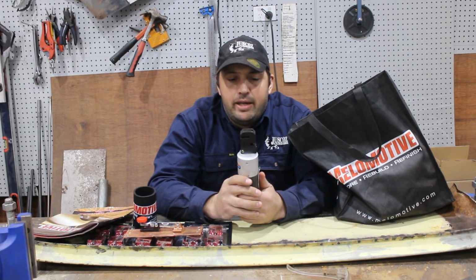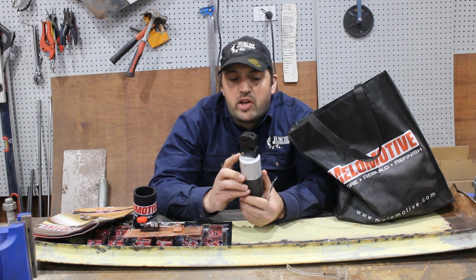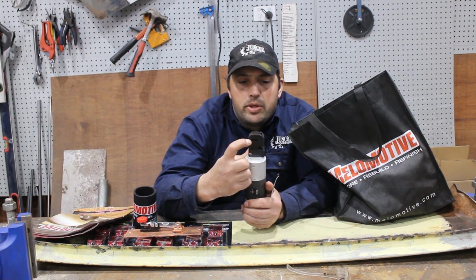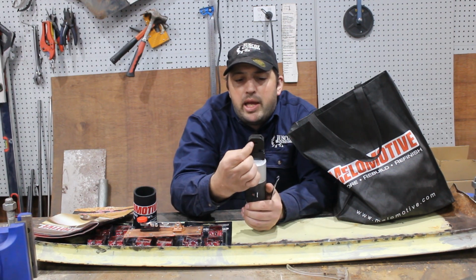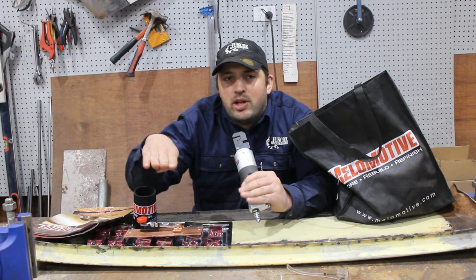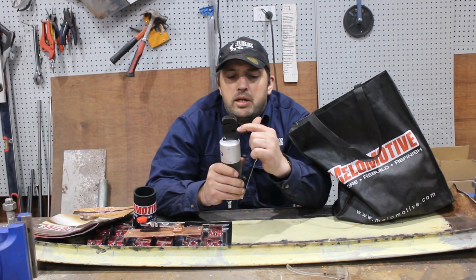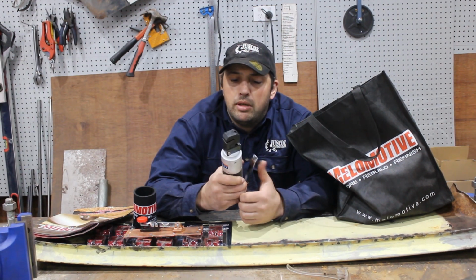And this big buddy. This is a punch and flange tool. I actually got this on sale. The sale might still be going, or it might have finished. This side will put a little step or a flange in the edge of a sheet. So it'll be a 12mm flange that steps down about 1mm, so you can overlap 2 sheets and they'll be flush on the top. It's really good for joining 2 pieces together. And on this side, it'll punch a 5mm hole straight through, up to 1.6mm I think it is.